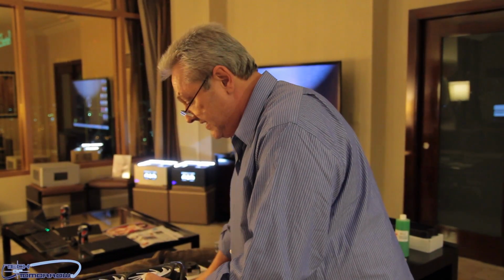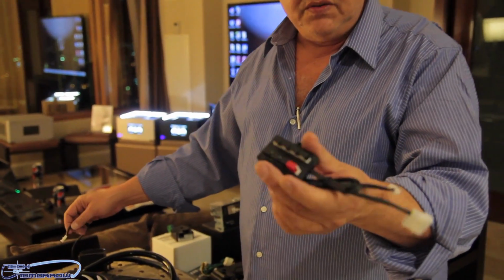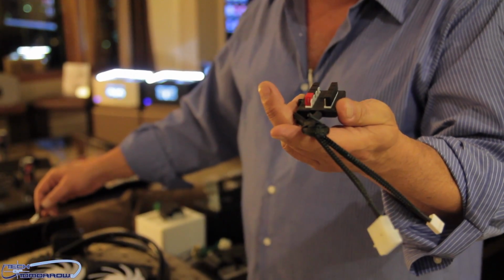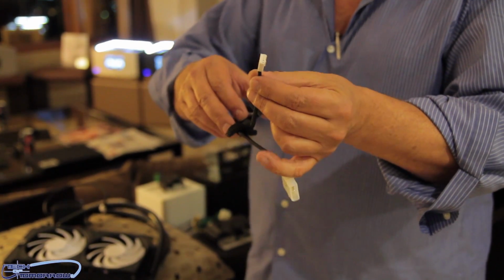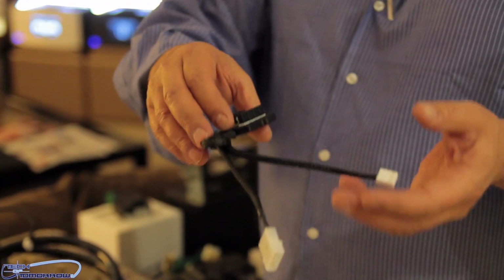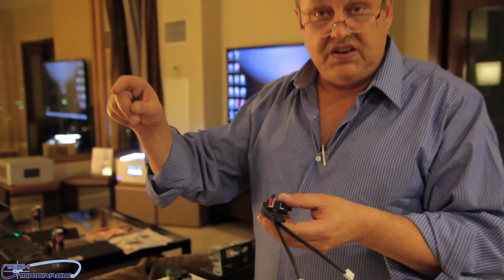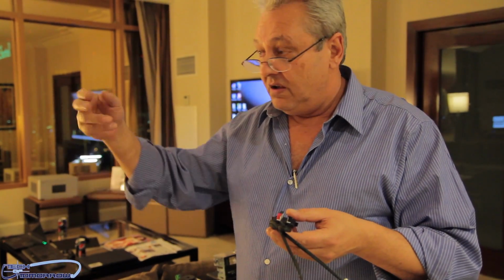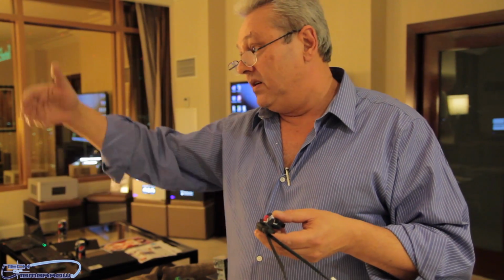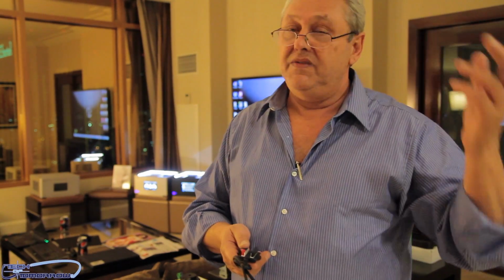The plug and play portion of it, connections: you just connect your CPU cooler to this little PWM splitter. All that system is PWM controlled. Connect your 2 fans to this, to the motherboard, and the entire unit is controlled by the motherboard. So there is no need for extra software. Essentially, put the settings in the BIOS, and the computer does the rest. And if you want more fine-tuning, use the motherboard supplied software, such as comes with every major motherboard manufacturer: ASUS, MSI, Gigabyte, and forgive me if I forget someone.